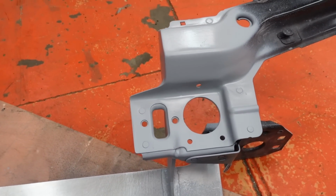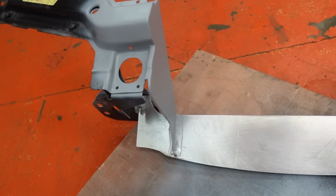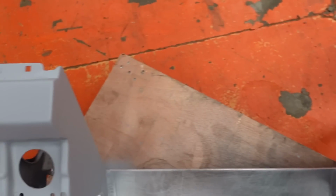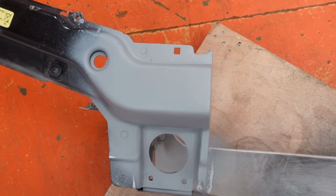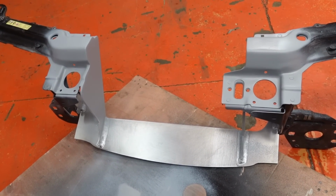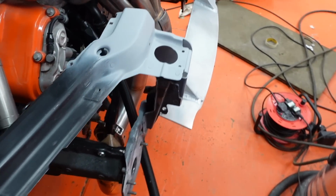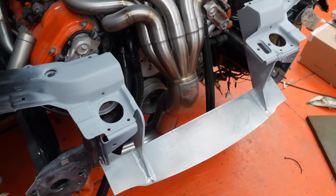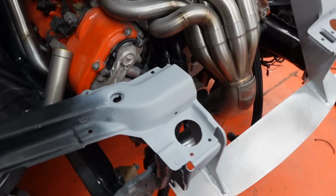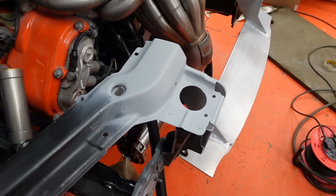It's not too bad for a first go. It's going to take quite a bit more prepping to get this perfectly smooth, but there's a few imperfections that I've seen, but now we're getting there. Bodywork is not my favourite thing in the world, believe it or not. We're finally getting somewhere. It's been on and off a few times. I've only got aerosol primer here, and the high build is only a 1K, and it doesn't really set like the 2K stuff.